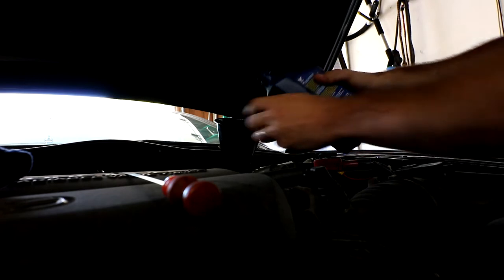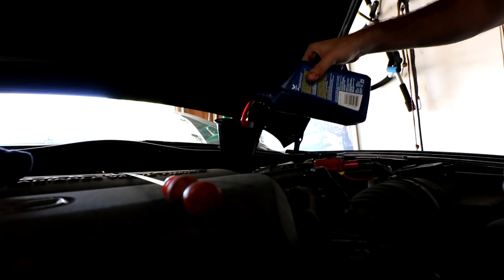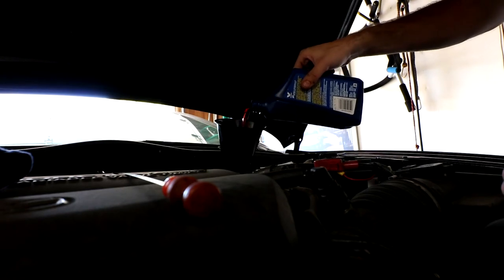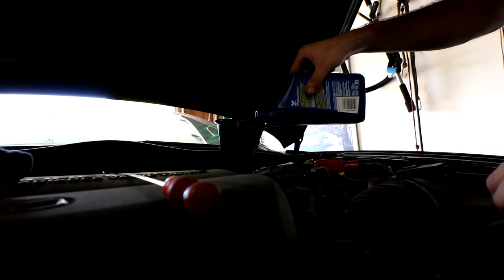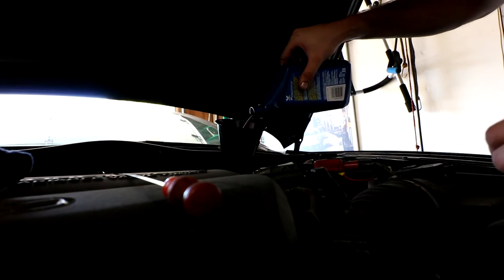This part's a very easy process — it's just cracking open these bottles and dumping them in. Make sure you have the bottom bolt on, or else this is going to go straight through from one side to the other. You'll notice it's a red color — kind of an amber, ruby red. That's clean ATF. ATF turns brown over time. As far as degradation goes, color doesn't really mean much — this stuff turns brown pretty quickly.